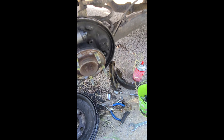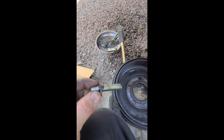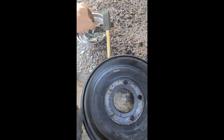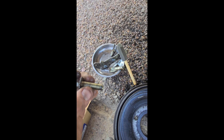With this all pulled apart, what we're going to do is clean up everything. For instance here, here, and here — any contact points where the brake shoes come into play — we're just going to clean them up a little bit and then throw some grease on them. We're going to clean this up as well. As you can see mine's a little bent — not sure what happened there, probably when we were removing it. We're going to clean up all the parts and clean up these contact points, grease them up. I just got some basic all-purpose grease.